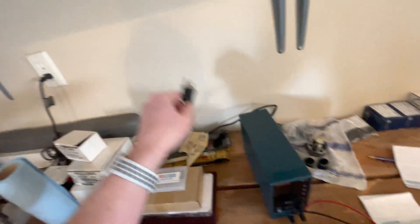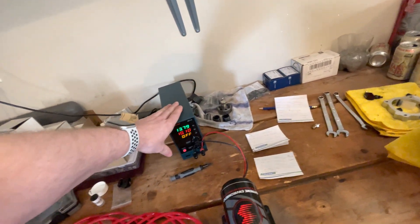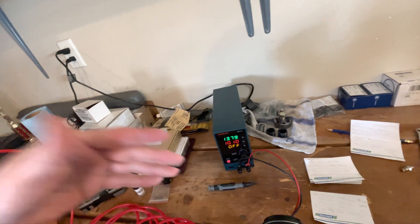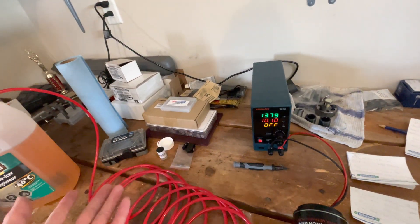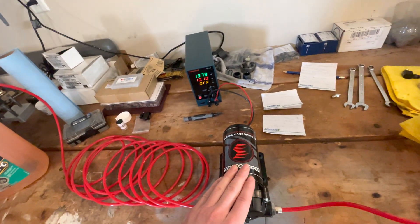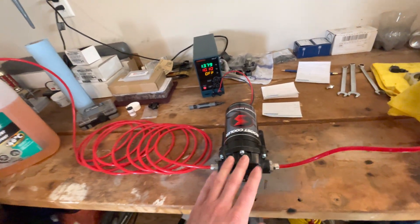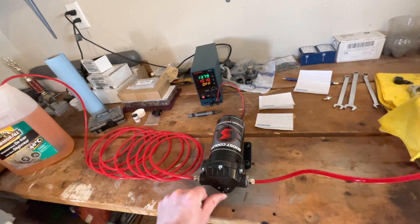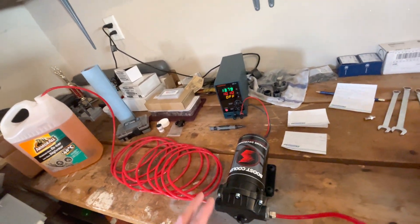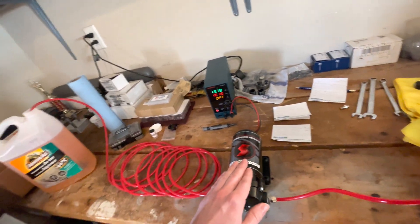I have a number four nozzle in there. This little measuring cup is my wife's — she is going to be pissed. For this test I plug it in, and I've got this little AC/DC converter power supply set at 13.8 volts. The reason I use 13.8 volts is that's your average AGM battery charging voltage. I have it set at 10 amps. This pump, if it goes over 9.6 amps, basically detunes itself. I physically tested it — if you put more load on it via the set screw, it starts detuning, jumping around in voltage.